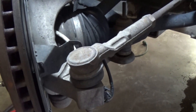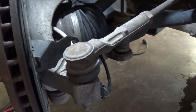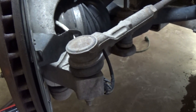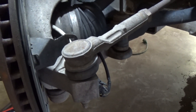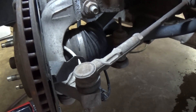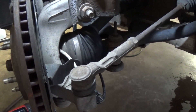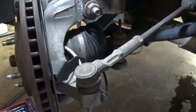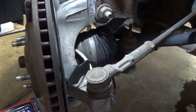Hello guys. I got this 2015 Chevy Impala. We have a problem on the front left ABS sensor — it keeps dropping down. I took the car for a test drive and sure enough, every once in a while it drops the signal. It's not one of those common problems where at low speed the amplitude is low and activates the ABS. This is more like when it goes over a bump — every time I go over the bump it makes a glitch.